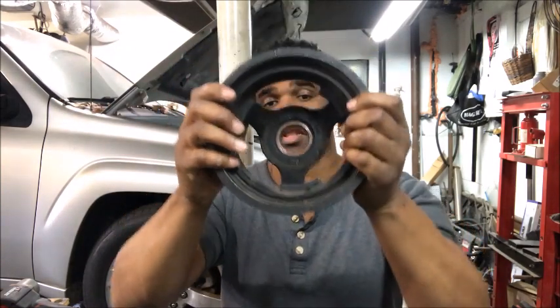This is how it works. With the LS engine, this is the crank pulley — a standard crank pulley. This is a pressed-on fit, that means you got to press this on to your crank. When you're pushing some serious power, the last thing you want is this thing spinning and you're not going nowhere. Because of the spins, you'd have to take the engine apart and send the crank to get machined. The great minds came out with a pin out kit.